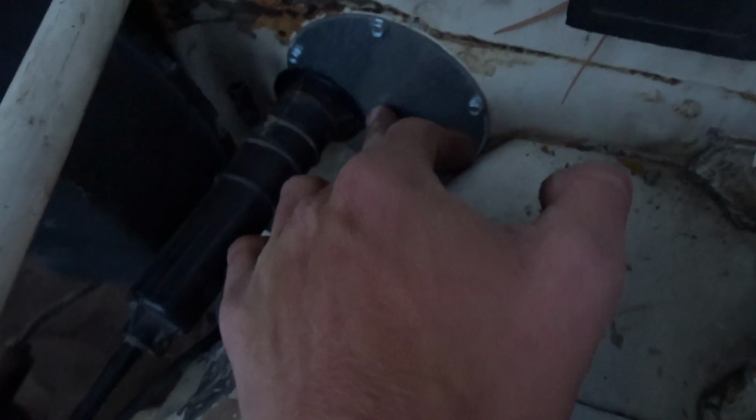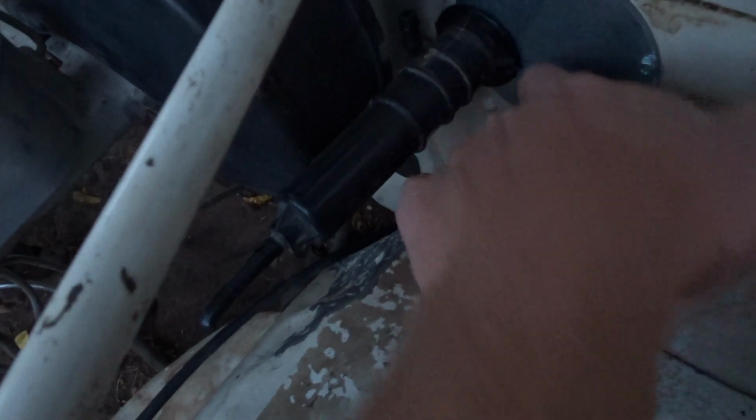And in case anyone is wondering, yes, this is self-tapped on. I understand that. It's not going to be permanent. I will weld this to the chassis, but right now the welder's way over there and the car's way over here. So, for mock-up purposes, I just self-tapped it. I'll just rosette weld those when the time comes and then weld this all the way around. Well, as much as I can, I won't be able to get it down there.